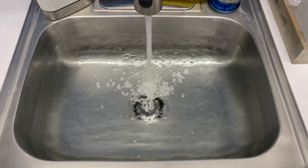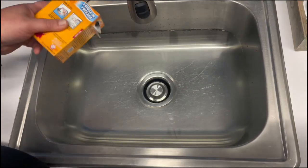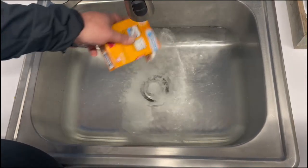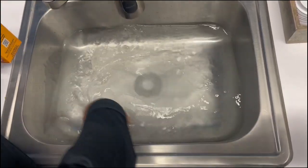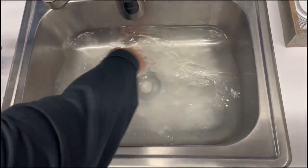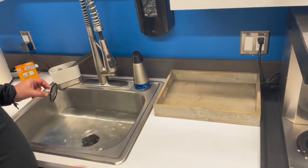There's going to be a lot of home remedies out there, but I'm going to show you what the manufacturer recommends. Go ahead and put a stopper on the drain and fill the whole sink with warm water. Then put in a quarter cup of baking soda, stir it in there, and make sure it's dissolved. Once everything's dissolved, go ahead and pull out your stopper and turn on your garbage disposal at the same time.